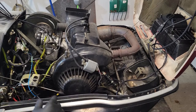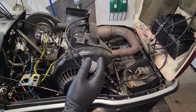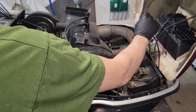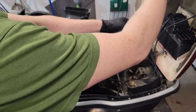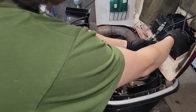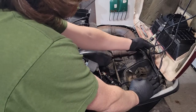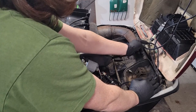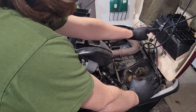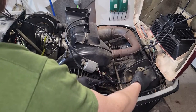Now for the modifications I had to make for converting it to DC on the lighting side, there's a little more to it. The harness coming down from the gauge light has a dedicated ground, and that ground splices into the headlight. This little connector I made separates that ground - it just terminates in the plug and doesn't go anywhere. The ground coming from the H4 plug goes into the new harness I made specifically for the DC stuff.